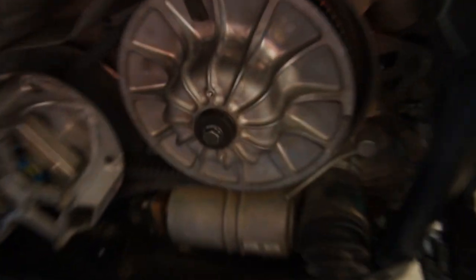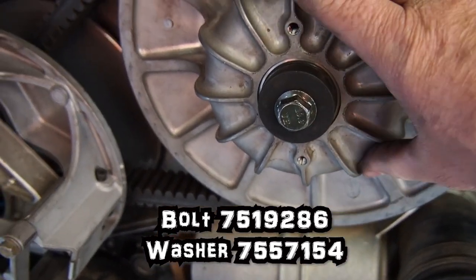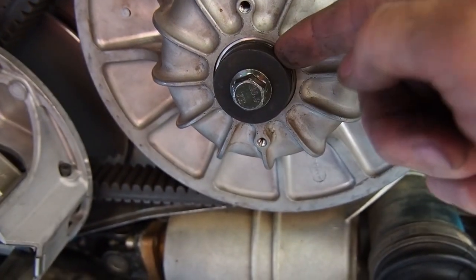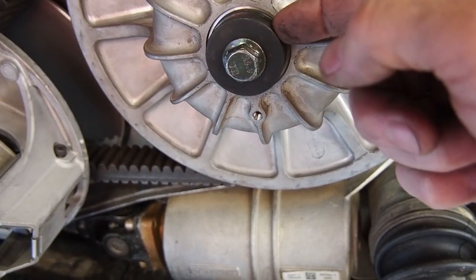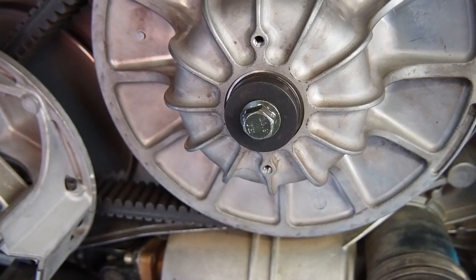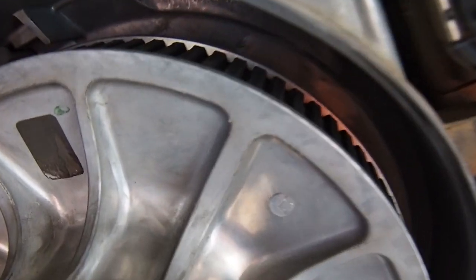In 2019, Polaris and Team Industries came up with a different design — basically their own version of a clip eliminator kit. It still has that washer with the weird hole in it, plus a big thick washer that fits over the shaft and creates the spacing, and then a longer bolt. It creates just a perfect amount of backlash so the belt sits correctly.